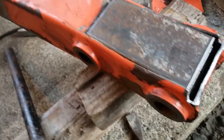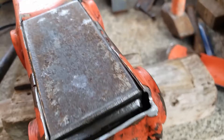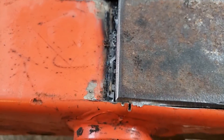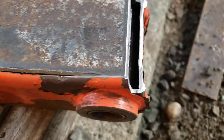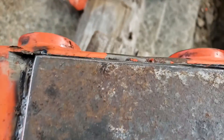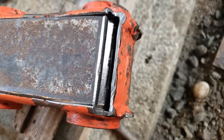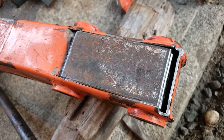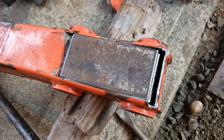I fitted the piece in, cleaned it all up, and I just have to clean up the painted surfaces here and get her ready to weld. It seems to fit pretty nice, and by the time I weld it all down in there, it'll almost look stock. And that's always the look I go for — something that looks like it should, even if it isn't stock.